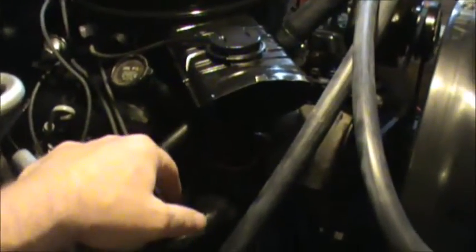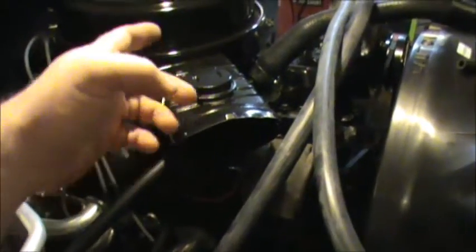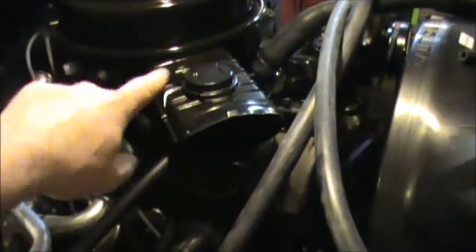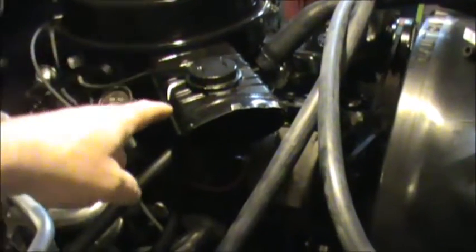And so yeah, I got my fuel line run. I've got to get some more clamps. I ran out of clamps. You can't see it under this thing here, but I ended up getting another steel 3/8 brake line and kind of went ahead and bubble flared the end and bent it a little bit and just tied it into the steel line coming up. And like I said, I didn't have enough small clamps, so I didn't quite get there.